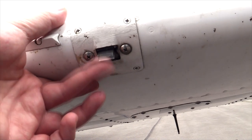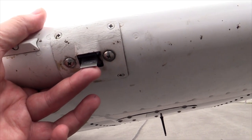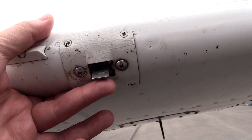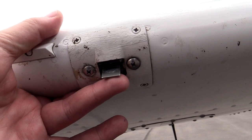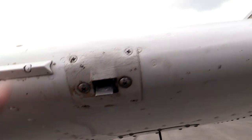This one is actually quite loose, a little bit too loose, so don't wonder if you hear the stall warning going off when we're flying. Normally it should activate 5 to 10 knots above the stall speed, but sometimes it will activate at 70 or even 80 knots. So keep that in mind, it's very loose.